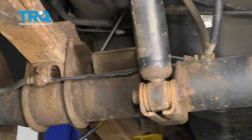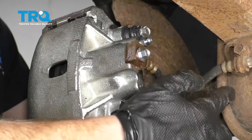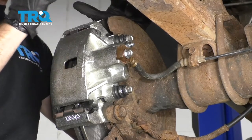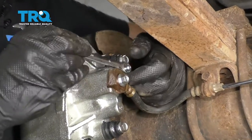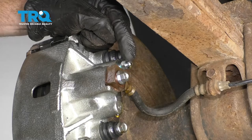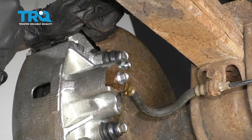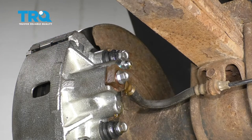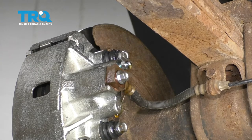Let's go ahead and get those hose pinchers off of there. Now the next thing we want to do is pump up the brake pedal — you want it to get as firm as possible. That's going to help force the fluid up inside the caliper where the air is. Then we're going to open this up and let it gravity bleed for a little bit to work out as much air as possible. Now that we have the brake pedal pumped up, let's open our bleeder screw and watch as fluid comes out. Give it a minute. We've got fluid coming out in a pretty good stream. We want to make sure we don't see any more air bubbles. Give it a couple of loving bonks and you can even try to move the flex hose around a little bit. Once you have a pretty steady stream of fluid without air, we'll close this and continue with a manual bleed.